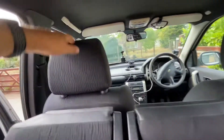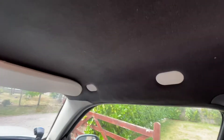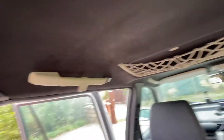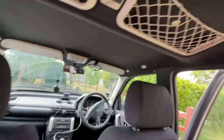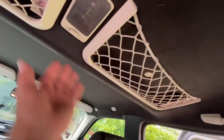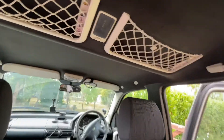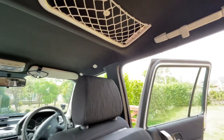Once you're ready to actually lower the roof, put the headrests down so you've got plenty of room. Get the blanks down out of the way — your visors, handles, centers, door handles — and there are two at the back as well. Then the thing will just drop out. Be quite careful because where the pockets are it kind of wants to hinge; it's a very thin fiberglass board so just try and support it as you take it out.